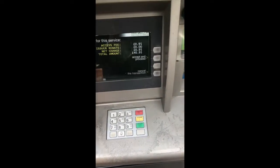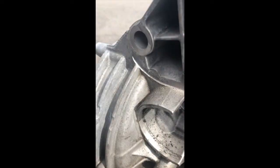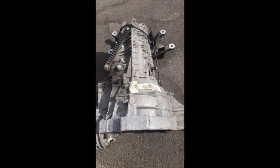I gave him a tenner for the tip. Residues around the gearbox, wet around, so I believe that was a slippage of a clutch causing the troubles. Oil as well here on top, after the last repair from last year.